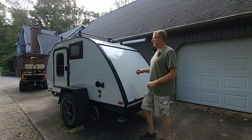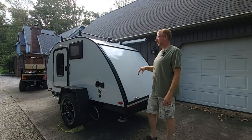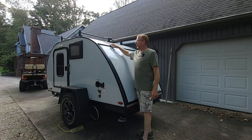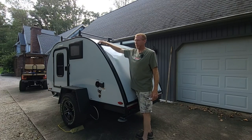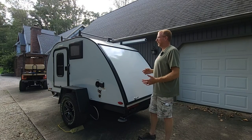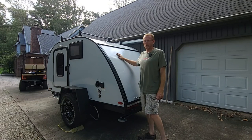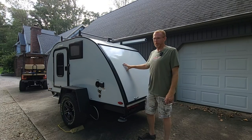I still need to remove this cap on this side, clean out that sealer, put a nice smooth bead of sealer in there — do that on both sides. That way when the water comes across the top of your camper and gets in this channel it doesn't have to rise up another half inch to get over this silly cap here. We'll want to seal that hole where the screw is holding on there and just clean that whole area up so that you've got a nice smooth transition for the water. That will really go a long way in helping keep your kitchen dry on your Bushwacker 10 HD, or really any Bushwacker 10 model because I'm sure they're all built the same.